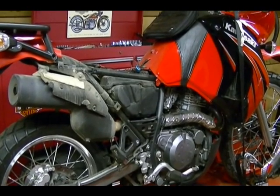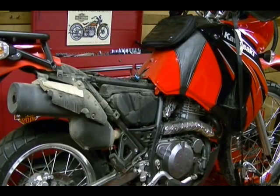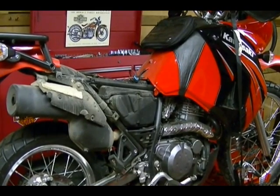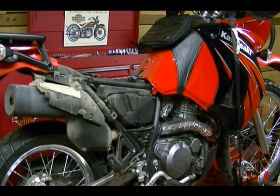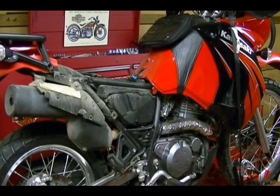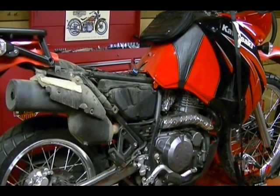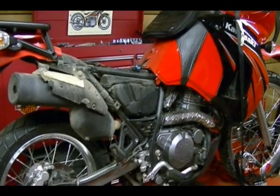On this bike I was able to just turn the fuel petcock to the off position and run all the fuel out of the bike. If your vehicle uses fuel injection, you can remove the fuel pump relay to disable the fuel system. But just follow whatever method the manufacturer of your vehicle recommends for disabling the engine.